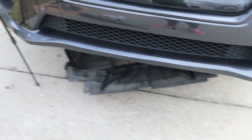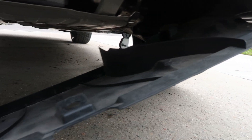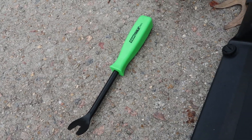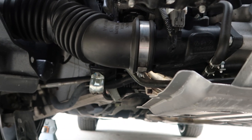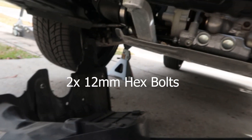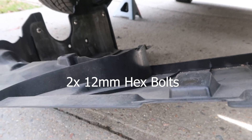Skipping ahead a few minutes — we also have to take off the skid plate, which was a pain. If you have the right tool it helps, but everything is very tight and most clips will likely snap off due to how brittle they are. With the skid plate down, you can see the turbo and the rest of the intake piping. Remove the hose clamp down there and the two 12 millimeter bolts holding the piping in place.